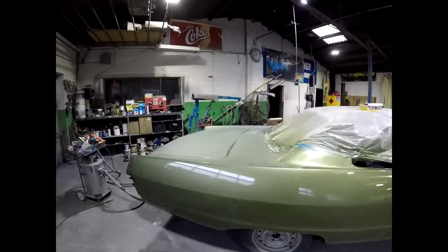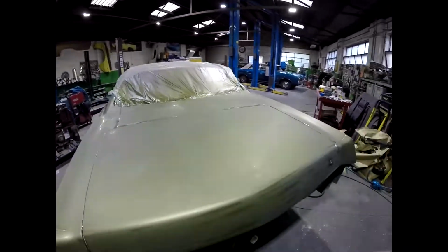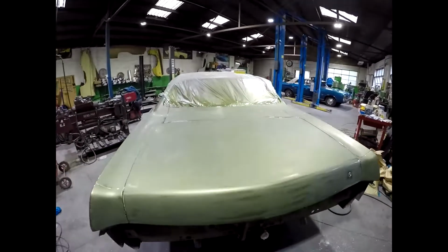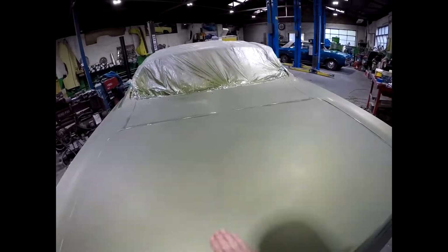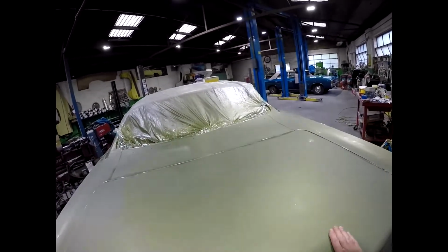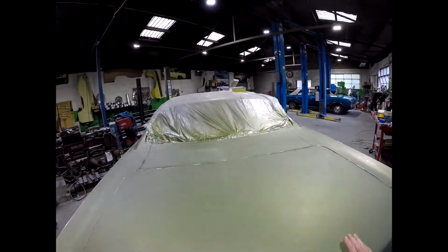And this is what you have to do if you want to get a nice, flat finish. This is basically the boot lid and a Dutchman panel sanded down to about a 1,500 finish. You can go further, 3,000, but I generally do the cars in the next couple of days after it's painted, and they tend to cut easier. Well, they definitely cut easier.